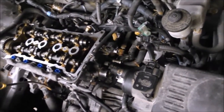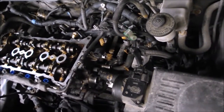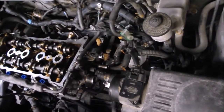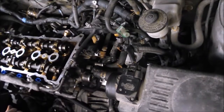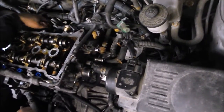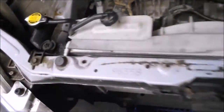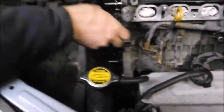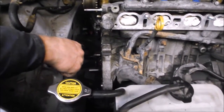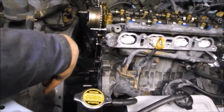If it was a newer vehicle you'd obviously just carefully unbolt the heat shield without any issues. So that takes care of the exhaust, which we left in place. Before you take the front cover off, there are a bunch of things you need to remove: you've got an alternator, a water pump, a power steering pump, and your crank pulley. You have to take all that stuff off.